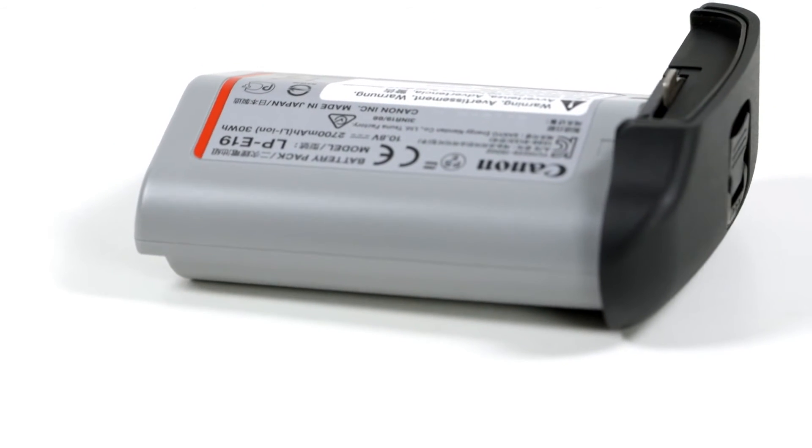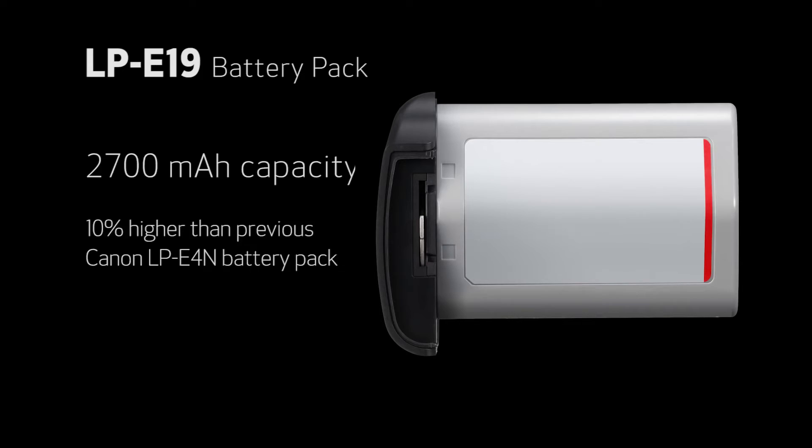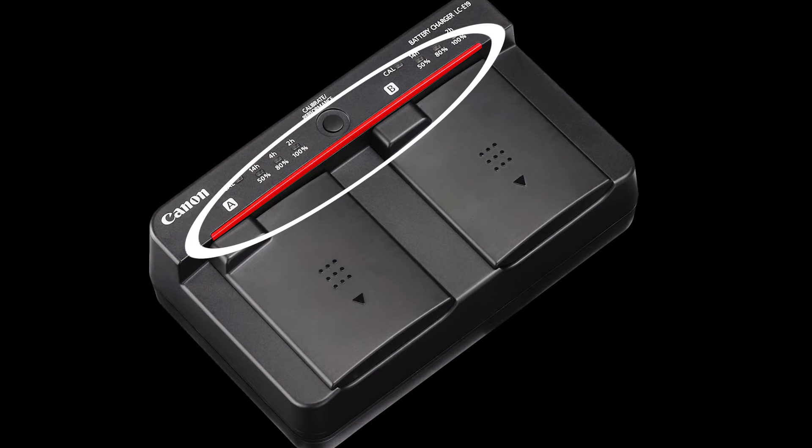There's a new battery pack for the camera called the Canon LPE19. It's a high-energy lithium-ion battery pack, easy to distinguish from previous generation batteries by its gray color and a distinctive red stripe. You'll see a similar red stripe on the new charger unit. This battery is the same size and has the same electrical contacts as previous generation LPE4 series batteries, so there is almost total back and forth compatibility. You can use older batteries in the new camera, though the maximum shooting speed will drop to about 12 frames a second. To fully charge the new higher energy battery, you need to use the new charger with the red stripe.